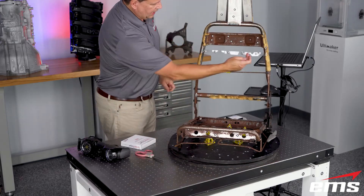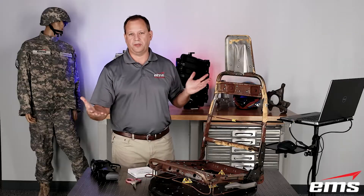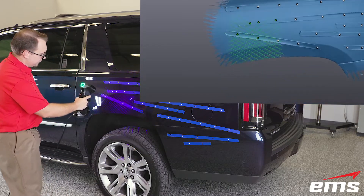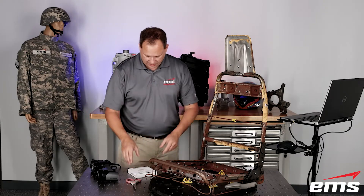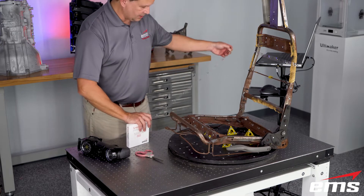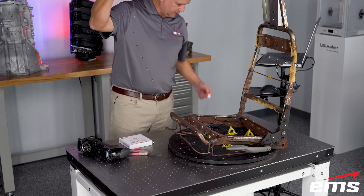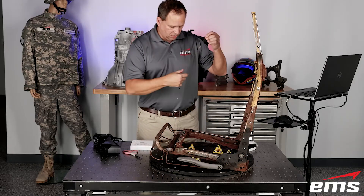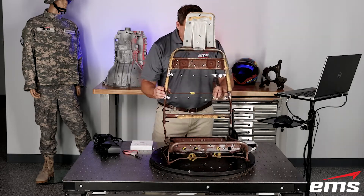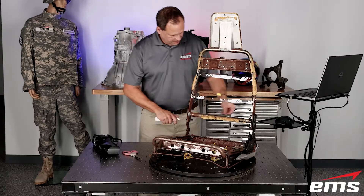The adhesive on here is pretty strong, but wrapping it ensures it stays. The reason it's clear is because if you put this on a vehicle surface, the scanner will literally scan right through it. Now you could do this with masking tape or painters tape, but those tend to be thicker and the scanner will scan that tape, leaving a big ridge in your scan data. With Speed Target, it's clear so the scanner sees through it. You can also reuse the tape — if it doesn't get too dirty, you can keep it. Obviously as the adhesive gets dirty or worn out, it won't work anymore. Let's do maybe one more piece down here and that should be good.